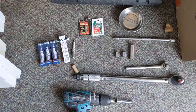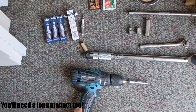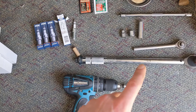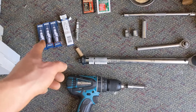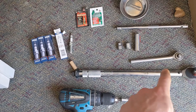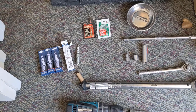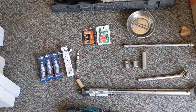We've got our tools ready. Four spark plugs for our Honda hybrid. We have a screw gun with a socket adapter so we can get the bolts out quick once we loosen them. A torque wrench — I'd say five out of ten necessity. This is definitely an oversized torque wrench; I recommend using a digital one if you're able to. Check the torque specs — each spark plug, depending on the thread sizing, has different torque specifications. We also have our ratchet, a 9/16 plug socket, a 14 millimeter socket, a 10 millimeter socket, as well as an extension and any potential adapters we may need. I like to have a magnetic dish so we can catch the bolts and not worry about losing anything.